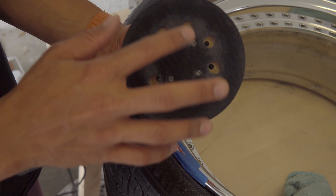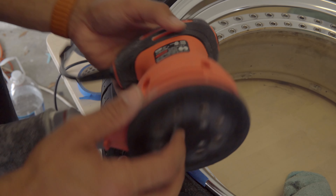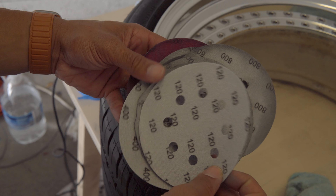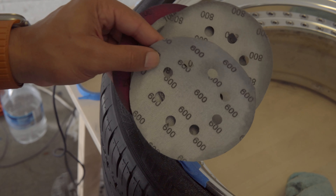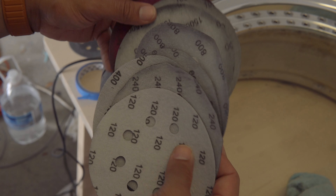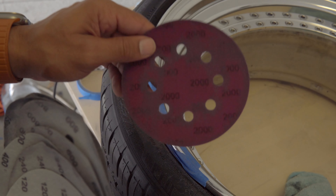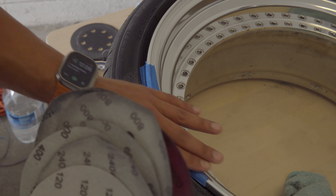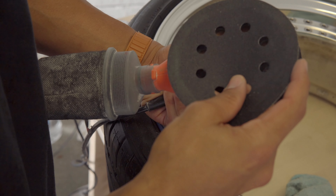This is what I use for the project — Black and Decker sander, I got this off Amazon, I'll put the link below. I also got a box of discs with a variation of different grits — I'll put that below too. We're gonna work through different grits: I did 80 first, then 120, working my way up to 600. When I get to 600 that's when I'll start wet sanding — spray water on it and sand it down. The higher the grit, the finer it is.